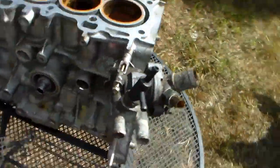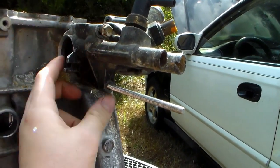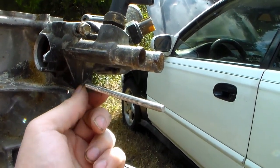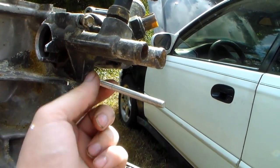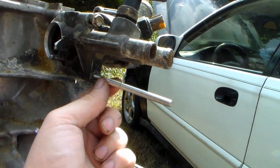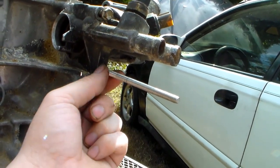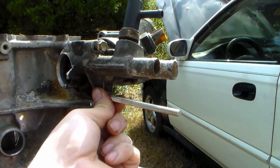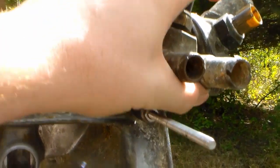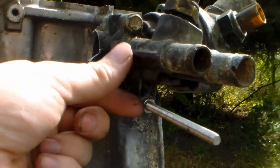So this is what I'm going for. The bottom part's not entirely tight, but if we tighten the top part, it'll keep the whole thing still. On the stud at the bottom, we can cut a relief so we can unscrew the stud if anything ever happens and we need to replace it. The main goal is to cut it down and mark it where we need it so we can put a nut over the top and tighten it down — that way the thermostat housing will be solid. I'll probably put a Honda nut down there so it'll have more surface area to grab onto.